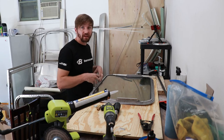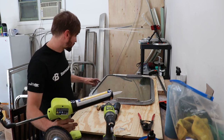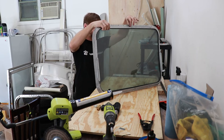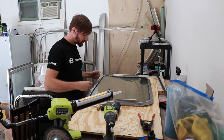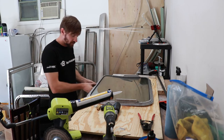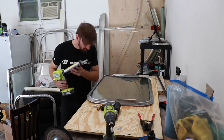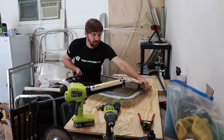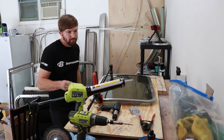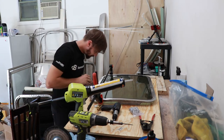Now I'm going to be riveting them together. I've got some Trem Pro 635 that I'm going to use to start off by sealing the gap between those. I'll seal it, clamp it, and then rivet it with solid buck rivets, then put the hinge across the top and do the bottom side. We're using one-eighth inch by half inch solid buck rivets.